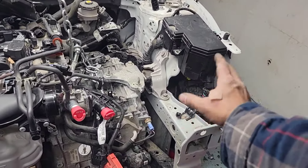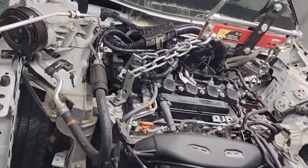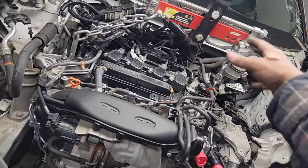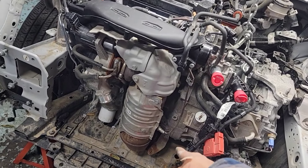But first we had to take out the wheels on both sides and take out the CV axles on both sides, and then the engine mounts and transmission mount, and this whole thing will come up. Don't forget the exhaust first.